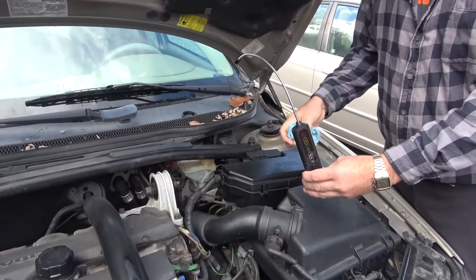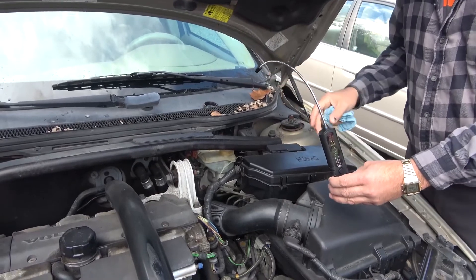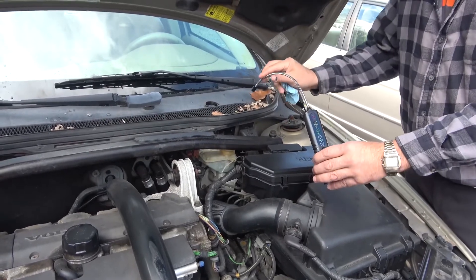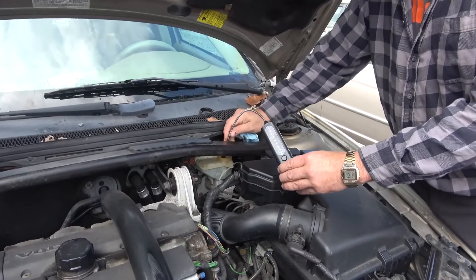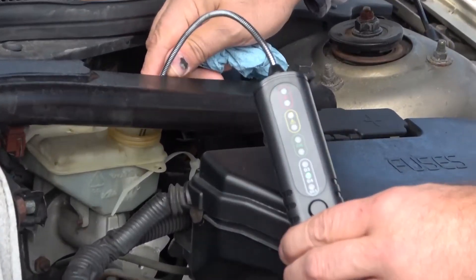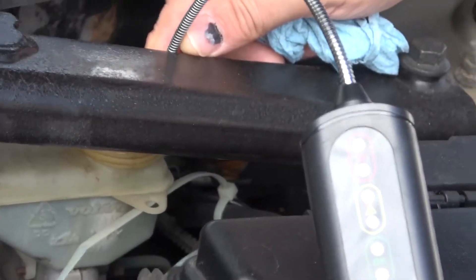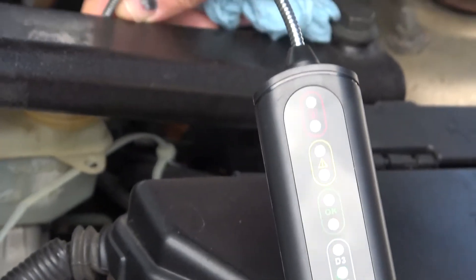For the last car, instead of the Volkswagen I decided to do my old Volvo. As far as I'm aware, this has never been flushed — it looks horrible, and just based on looks I'd definitely be recommending a flush on this. I've got it set to DOT 4. Stick it in — it's still giving a caution, although it's a higher caution. You can see the contaminants and moisture level is higher. It does appear the tool works fairly accurately, and I'm pretty happy with that.